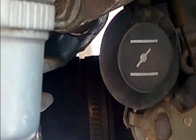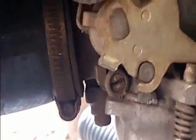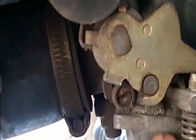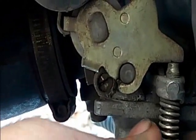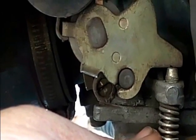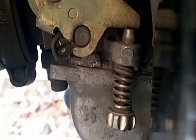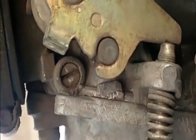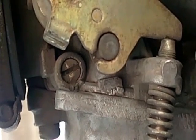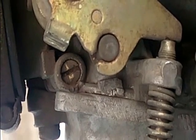One, two, three, four, five, six. Now this is on 6 turns — 6 half turns, that means 3 full turns. If you close or rotate the screw clockwise it will close the vent inside the carburetor, meaning that is the zero level.